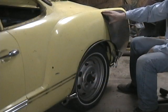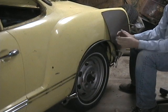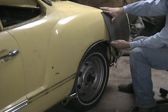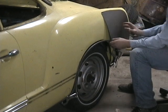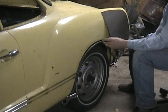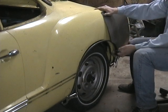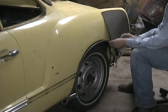If you're having trouble deciding how many pieces it's going to take to make a flare, it has a lot to do with your paper pattern and how easy it is to make it lay down. The metal will respond in pretty much the same way. So if you're trying to do too much with one big piece and you're getting the metal buckling up and it won't go where you want it to go without popping up somewhere else, that tells you that you're using too few pieces.